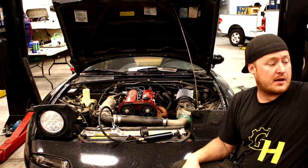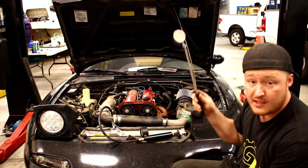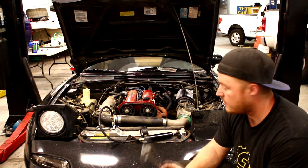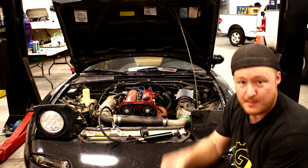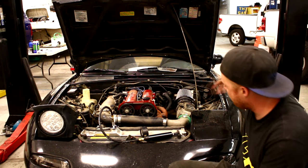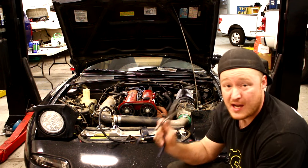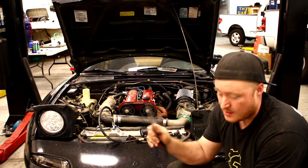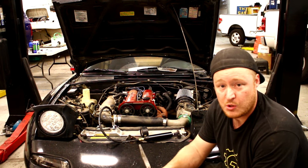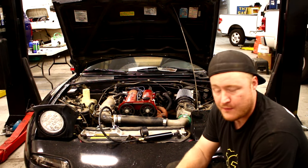I did look underneath in the back after I tightened that hose clamp using a mirror like this — these things are super useful, I highly recommend them, I'll leave a link in the description. It will definitely help you if you're ever trying to find issues or leaks on your car. I used a couple of small extensions with a universal joint in the middle for an 8mm, because I have a worm clamp on mine. From the factory they were squeeze clamps, so long needle-nose pliers should help you out. If you guys enjoy our videos and find them helpful, go down to the description and hit up those Amazon links — it really does help us out.